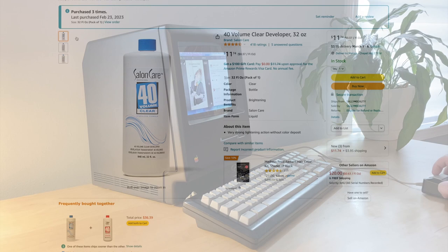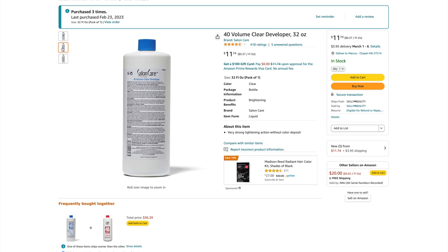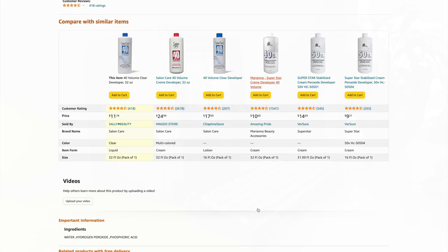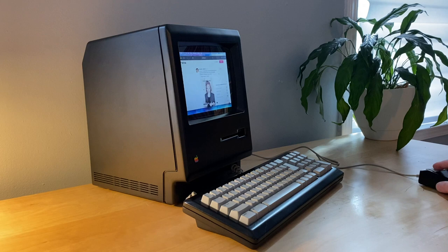I prefer to use Salon hydrogen peroxide as opposed to the actual Retr0bright product. Hydrogen peroxide is 95% of the Retr0bright product, so it's basically the same thing and it's half the price. So the Salon hydrogen peroxide will be linked in the description below. Make sure to wear latex gloves when you are retrobrighting. And in my experience, it's best to retrobrite by spraying the hydrogen peroxide on the pieces every 15 minutes in the sun and rotating them to make sure to get all of the sides.